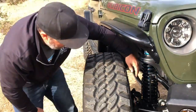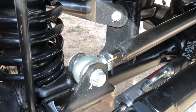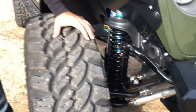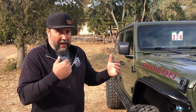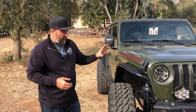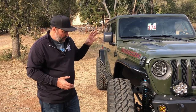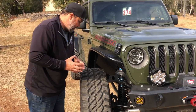Another thing you can see in here is one of our new products — this track bar. That track bar is our new WFO Heavy Duty JL track bar. It has FK Heim joints top and bottom with a chromoly uniball style at the top with a wobble stopper. We believe it's the best track bar on the market. It allows for the most up-travel and the most clearance on differential covers. A lot of other track bars say they clear Ultimate 60s, but if you cycle them all the way, they don't. This one definitely clears the one-ton axles the best — we're pretty proud of that new track bar.